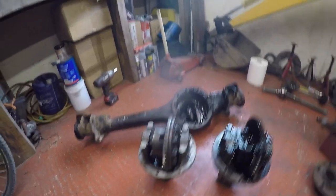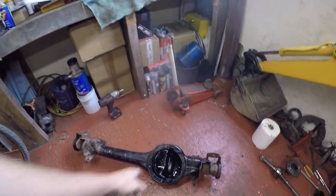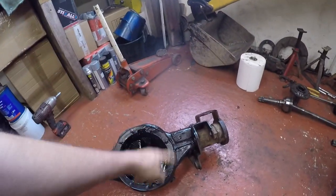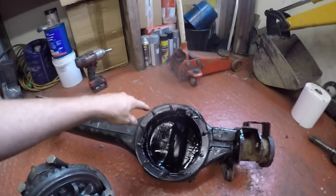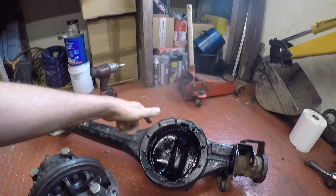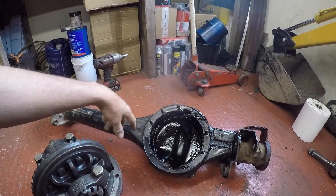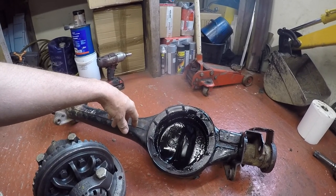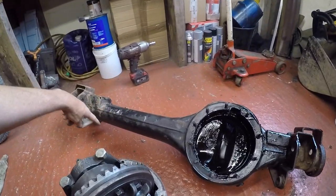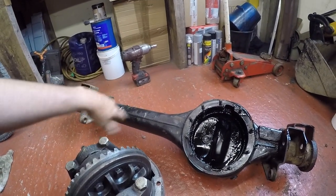I did do a conversion on my green ting where I fitted the short nose rear diff into a front axle casing. What you do is knock all the studs out, weld them all up, do a bit of grinding, cut the diff pan off the back, re-drill all the holes, and set it all up with the half shafts in to centralize it perfectly. On the green ting I reinforced it with some box section and bits of steel.